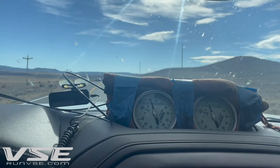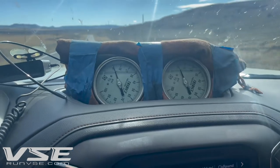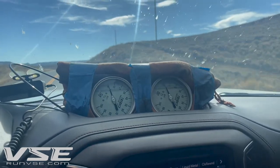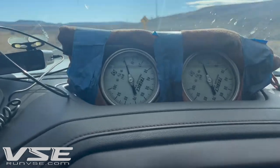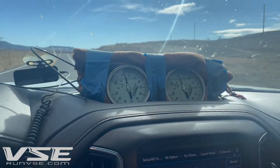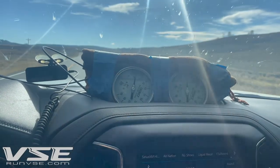How much drive pressure is too much? It's literally all over the place depending on load, adiabatic load meaning how much load under boost, engine RPM, and compressor flow. Right now going down the road I just toed into it and we're at a drive pressure ratio of about five pounds of boost to eight pounds of drive. You could easily get three or four to one drive pressure ratio — you just toe in, the turbocharger comes up on boost, drive pressure goes way up before boost pressure goes up. That's just kind of the way it works. The VGT closes down and builds two things: exhaust heat, which is called enthalpy of the exhaust, and exhaust pressure.